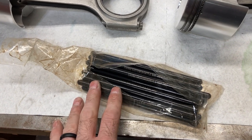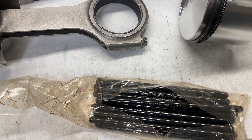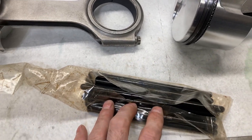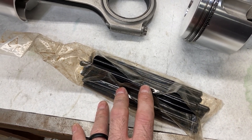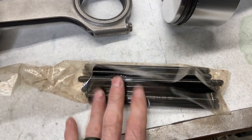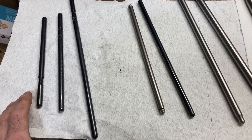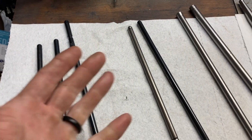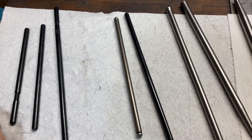I've used them all — they produce very high quality, accurately machined and assembled parts. I have not ordered the push rods yet for our 427 medium riser because it uses non-adjustable rocker arms. Once the heads are assembled and torqued down, I'll go through and measure for each push rod individually, taking into account lifter preload and get those ordered. Selecting the right push rod revolves around several factors — length is obviously one of the biggest. If the length isn't right it throws your geometry off or sets your preload incorrectly.